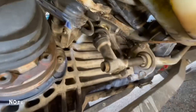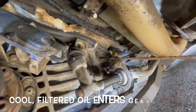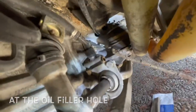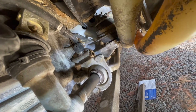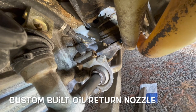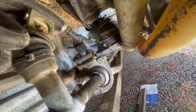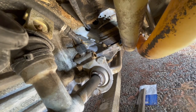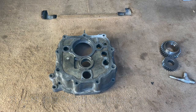The oil goes into this fitting right here, right behind the shifter mechanism, and it goes into the oil filler hole — right back into the gearbox. On this gearbox, that fitting has a nozzle on it, and the nozzle squirts the oil in a very specific location near the fourth gear mesh, where it also gets into a little passageway to lubricate the main shaft bearing.